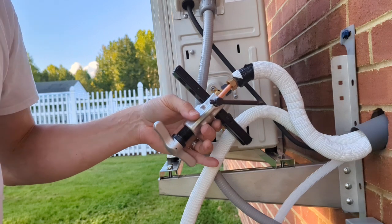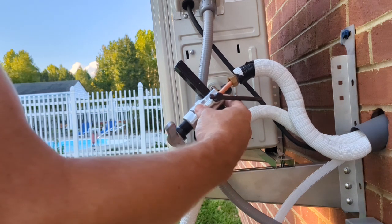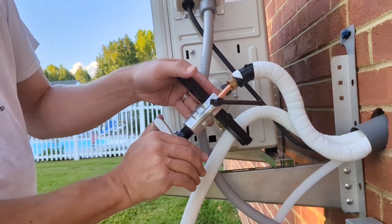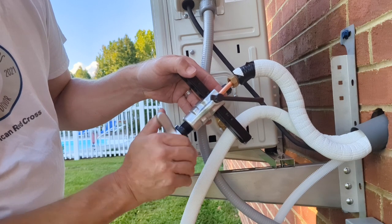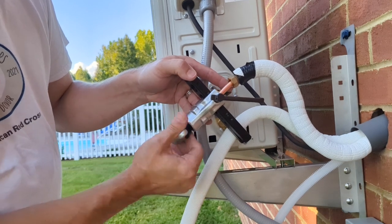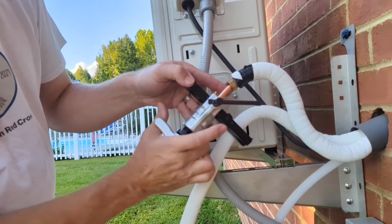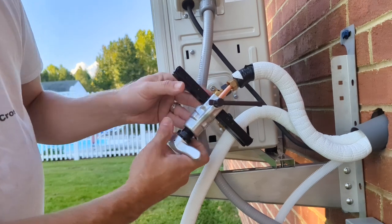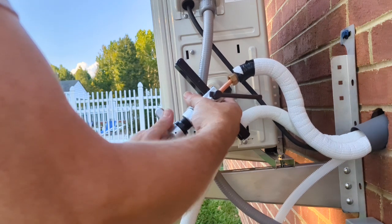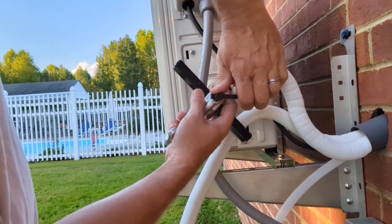Alright. Bite. I don't know how long I'm gonna be out here, but alright, then we just spin this guy. Basically crank this guy until it clicks. I will say this is a lot smoother than the other brake line set I got. See, it just snapped. Yeah, see, it doesn't do anymore. So it's basically done at that point. And then you just have to back this out all the way. Make sure it'll clear those little dentions, and you take this and pop it loose with it.